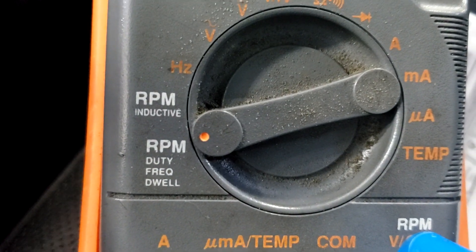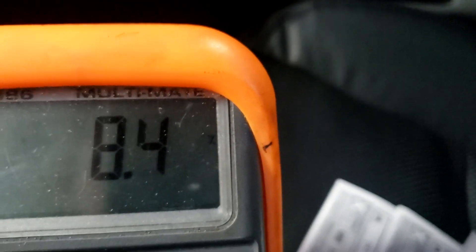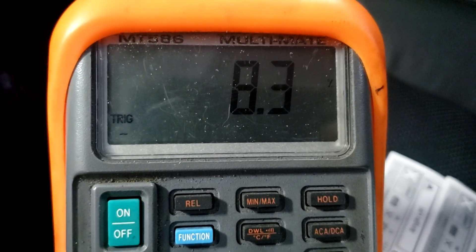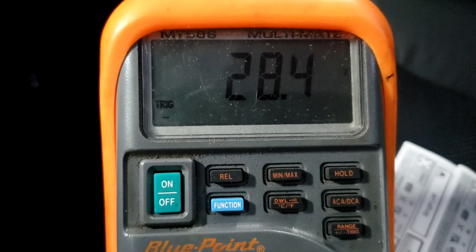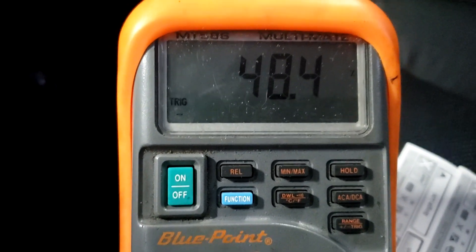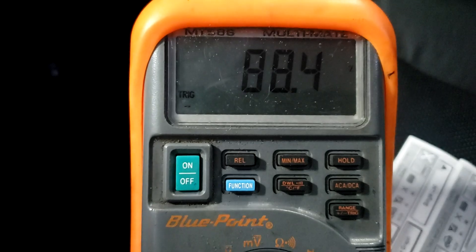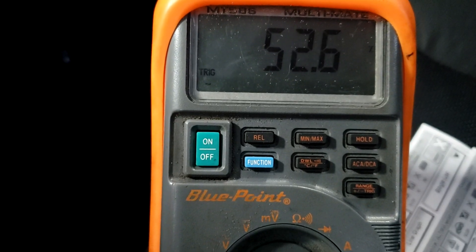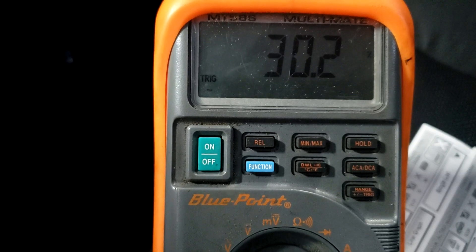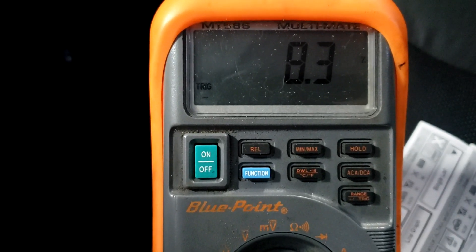For any non-scopers out there — if you don't have a scope yet and you have a volt meter with a duty/frequency setting — set it to a negative trigger and watch the percent. I'm just adding some percentage just like I did with the scope, and you can see the duty going up. You can actually test this system live if you don't believe your scan tool. I'll run it all the way up to 100. A volt meter only samples about four times a second, but at least it'll confirm the system can be commanded. You don't have to rely on the scan tool alone. Back down to 10% — scan tool shows 10, volt meter shows 8, and when it says zero, it's at zero.